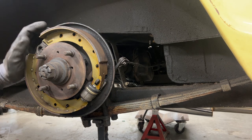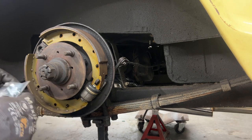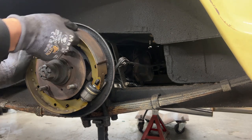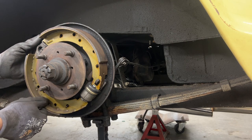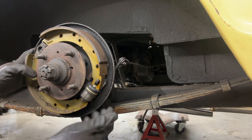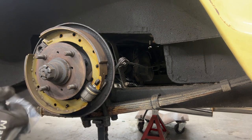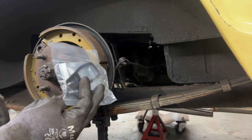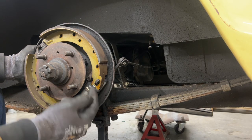The rear drum is out. Here you can see these are the retaining pins and clips that hold the brake shoes and stop them from moving around — right now they were missing, which isn't healthy. Before we install those, we're going to take everything apart and change the mounting hardware on the wheel cylinder. It looks like someone changed the cylinder but used the old hardware and didn't lubricate it.